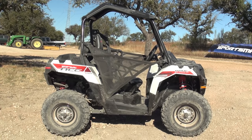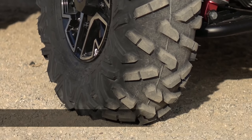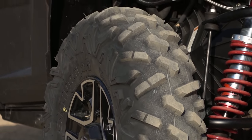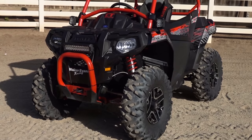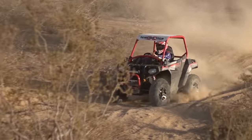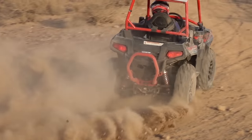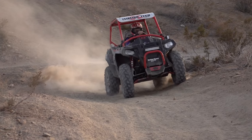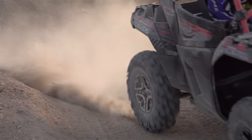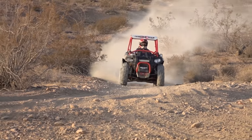Switching from a 25 to a 26-inch tire allows the ACE to roll more smoothly through bumps while improving ground clearance. Maxxis Bighorn 2.0 tires are some of the lightest all-condition radial tires on the market, making them a very good option for smaller displacement or single-cylinder engine machines. We used 26x9x12 tires all the way around. The rear tire's 1-inch narrower width reduces weight and narrows the tire's contact patch, helping reduce rolling resistance for quicker acceleration and making power slides a little easier and more predictable. Maxxis 2.0 tires provide good acceleration, braking, and directional control in sandy and rocky western trails, and they really shine in the sometimes rock-hard, sometimes muddy trails found in the woods back east.